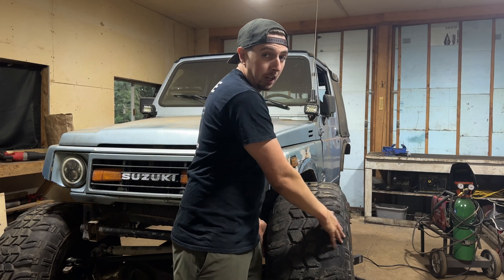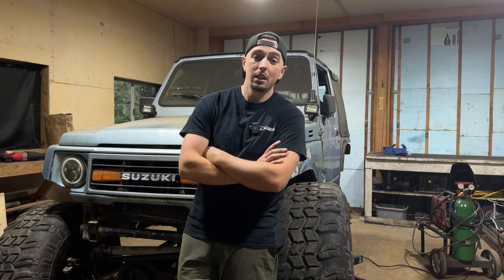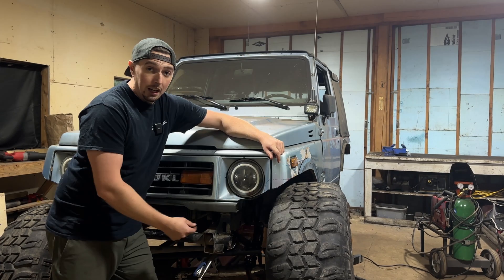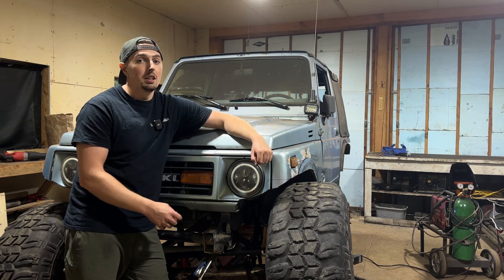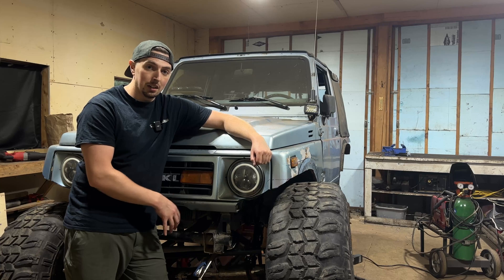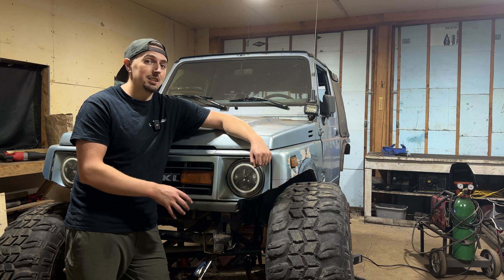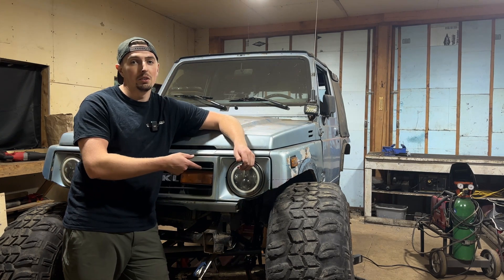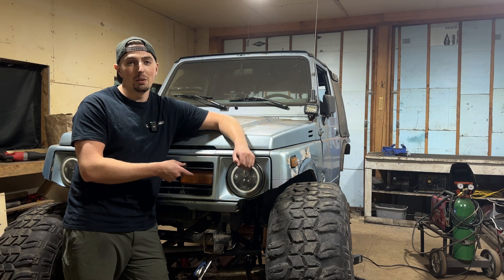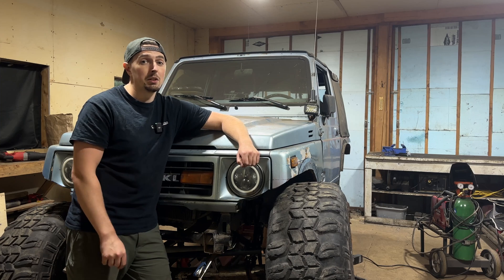These tires are quite a bit wider — they're 14.5 inches wide. So I'm thinking if I bump up the tire size and go with something a little bit narrower, like a 12.5, I should be able to make that work. The panhard bar is going to need some fine-tuning. I need to get these mounts designed and cut out on the plasma table. What I have mocked up right now definitely helped, but it's still flexing because it's not fully welded to the frame and the mounts aren't very sturdy. Getting that properly designed and tacked on is going to do me a lot of favors.